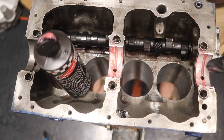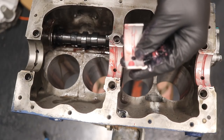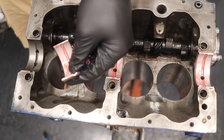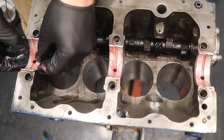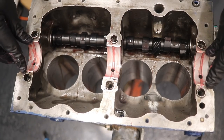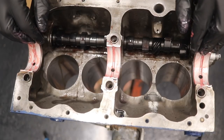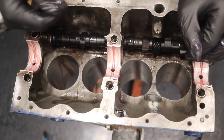These pieces only go in one way — nothing fancy, just slides in. There's a notch on the end of the bearing that pops right into the bearing seats. The channels inside are used to direct oil up to the crankshaft, keeping it lubricated and cool — that's how your motor prevents premature failure and overheating. For this 1275 build, you have a 1275 block, 1275 bearings, and a 1275 crank, and all the holes line up. On some other builds — I cover this in my 998 rebuild — those holes might need to be machined to allow oil to pass through.